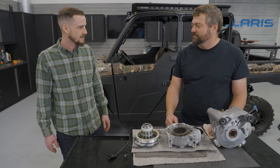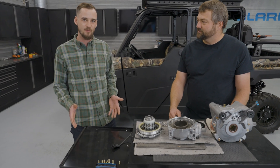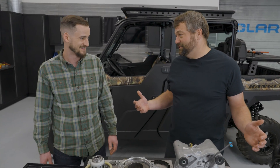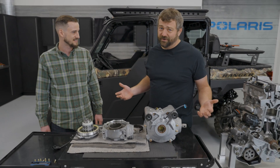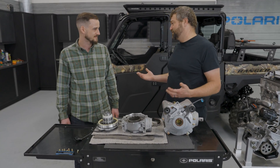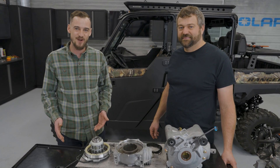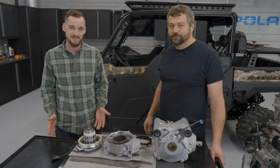The one thing to remember is when you're going to be driving on your grass, that's the one situation where you do want to get out of all-wheel drive. In all-wheel drive, your rear differential will be locked together, so if you get home from a day of trail riding, unload the vehicle from the trailer, and pull it into your yard, make sure you flip into turf mode so you don't tear up the grass. Those are really the basics - you don't have to switch between modes while trail riding. You can put that vehicle in all-wheel drive and this simple but ingenious system will adjust to what's needed, providing more torque to the front end when needed without making your steering difficult like a lot of other four-wheel drive vehicles. Thanks for watching!